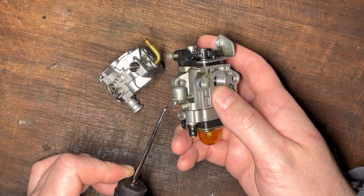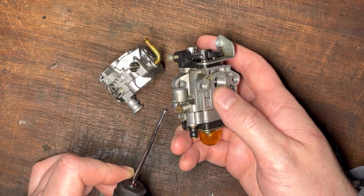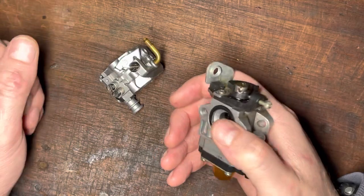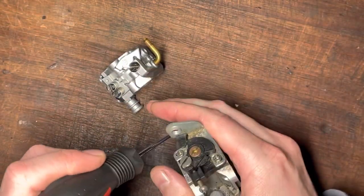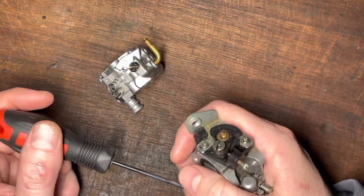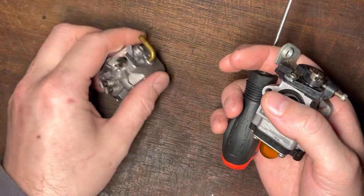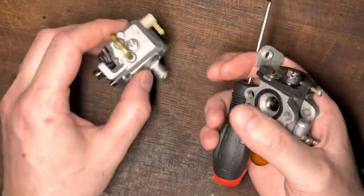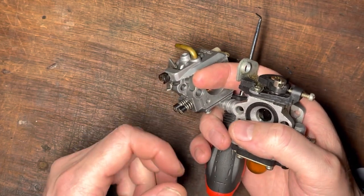What if you start your engine and you can get it going, but slowly the RPMs come down while it's just sitting there idling, and eventually it stalls? That can be two symptoms. Most commonly it's too rich on the low side — what we call loading up. I'd suggest leaning out the low side slightly, and if that makes it worse, then you know it's not actually loading up — it's just not getting enough fuel.